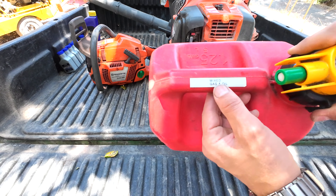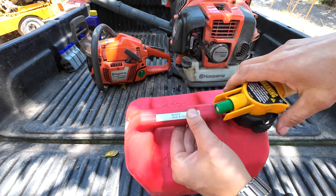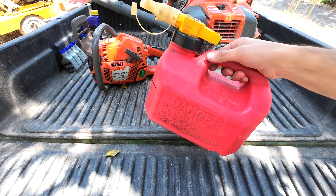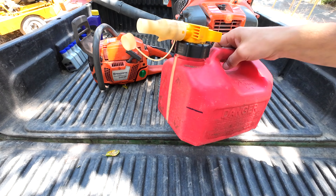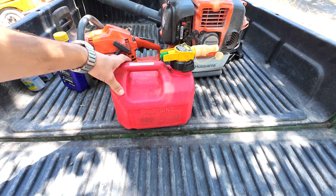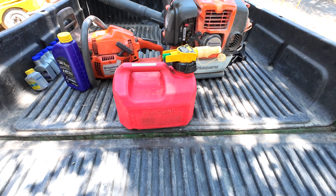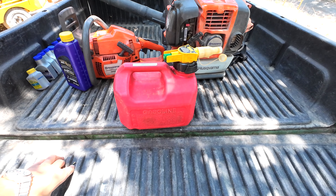After you buy this container, make sure you label it. I have written 'mixed gas and oil' on mine, so I know nothing else goes in here unless it is mixed gas and oil. Whenever I have to fuel any of my two-stroke machines, I go to this container. If it's empty, I make more mixture, like I'll show you right now. If it has something in it, you just use it up until it's completely empty — it has to be fully empty before you make a new batch. If you're a one-man operation, you really don't want a container bigger than this, because you don't want the mixture sitting around unused. You want to use it as fresh as possible. Even with that said, sometimes this thing sits here for a couple of months and I've had no ill effects.